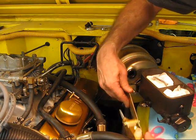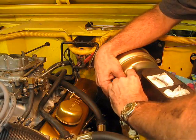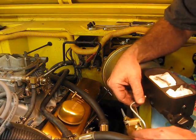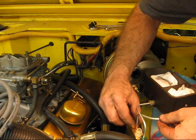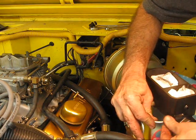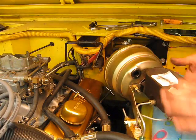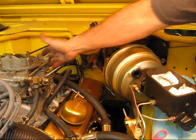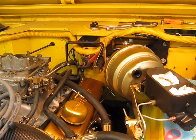So I'm just going to mock this thing up, kind of how it's supposed to go together, go ahead and put the little lines on it and everything. I didn't hook the pedal up on the inside yet, but I'm fixing to. Let's try it like that — yeah, that's how they want it. And it threads right in nicely. Look at that — see how nice that fits? It's a good fit. And then a simple check valve here on the top of the booster runs over to a port I have on the backside of the carburetor that's blocked off right now. So what I really got to do is just hook up the inside there.